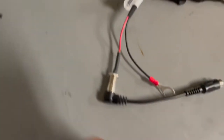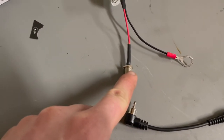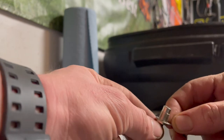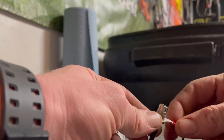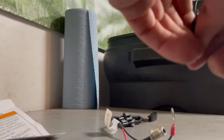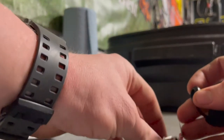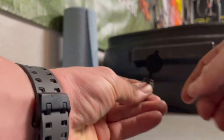This plugs in afterward, and what you do is this pops through the plastic. You're actually going to hook your connector — so this connector is what goes through the plastic. Before you put it through, the instructions say to put the ground over the threaded portion and that pushes through. Then this little cap threads on and sandwiches the plastic layer of your dashboard together.